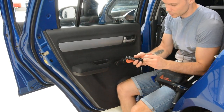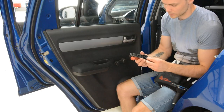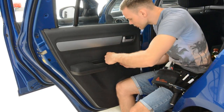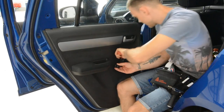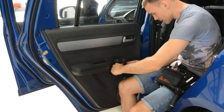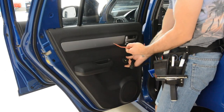This is from the upper door. It has a metal clip on this. We need to remove this metal clip. It's not easy because you don't have space. You need to put something in and push. After you remove this metal clip, it comes out very easily.